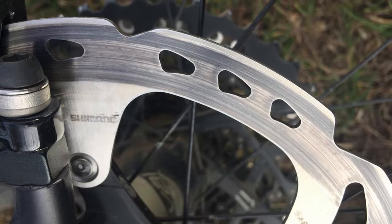As I started this video off, I said I'm not sure if these rotors will work with SRAM brake calipers, but I did run them with Shimano XTR brakes, which means they'll work on XT or SLX. The pad clearance is close, so you will have to readjust your caliper, but they will fit. I would suggest making sure your pistons in your caliper are pushed all the way inside to ensure they fit, then reinstall your pads and insert the rotor with your wheel. If your wheel is out of true, you'll need to get that sorted first. These rotors with a new set of TRP pads or MTX pads are going to bring your brakes to a new life — a strong level of performance improvement to your calipers at a price well under a new set of brakes.